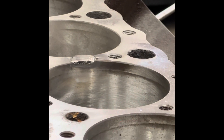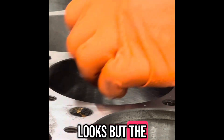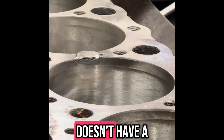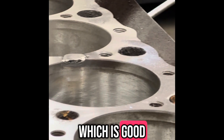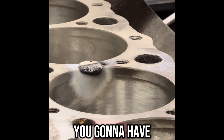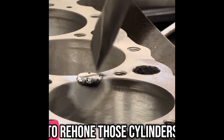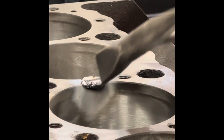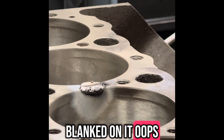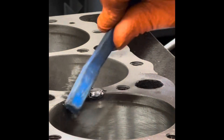You're going to need to weld a little bit more right there — I don't like the way that looks. But the rest of it looks pretty good. It doesn't have a bunch of pinholes in it, which is good. You're going to have to run it through the surfacer again, and I'm going to have to re-hone those cylinders. I should have done this first but I completely blanked on it — oops, it happens.